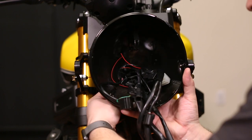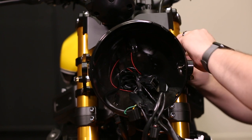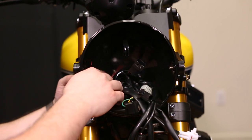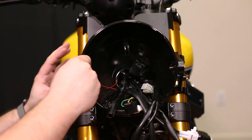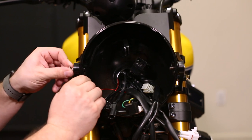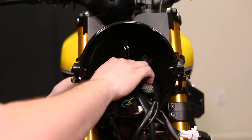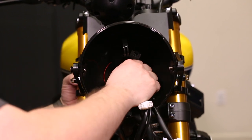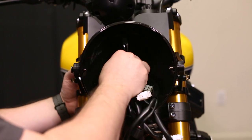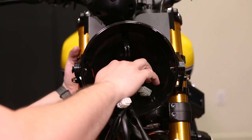Do some more adjusting. You might need to adjust the side brackets a little bit to get them a little lower. Basically what we're trying to do is make sure that none of the wiring behind the bucket is interfering with anything else and isn't being pinched against anything on the frame. Once we can get the other headlight bolt started, it gives us a good idea where the headlight's going to sit. Move the whole harness around until everything kind of sits where it wants to sit, and we don't want anything binding or kinking on the backside.